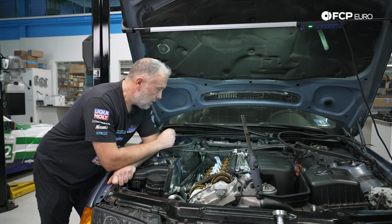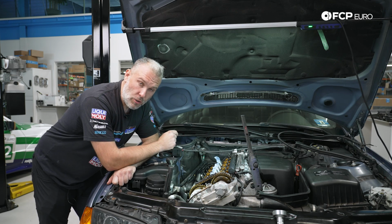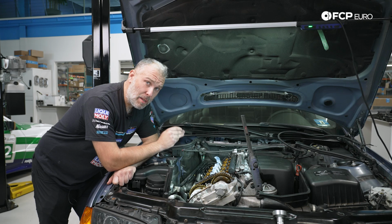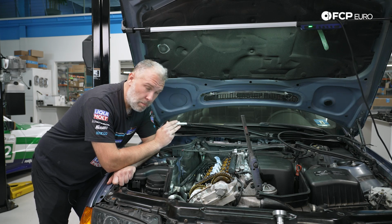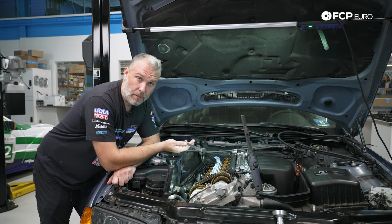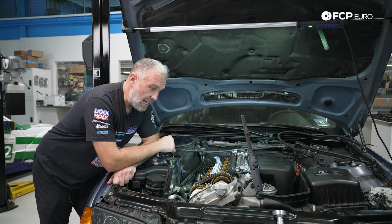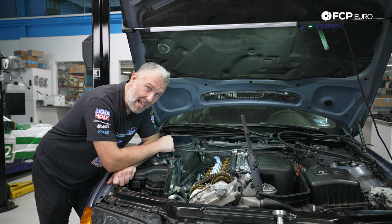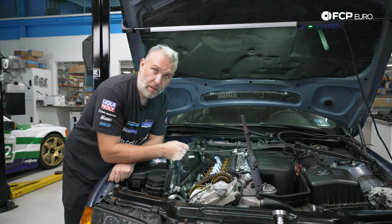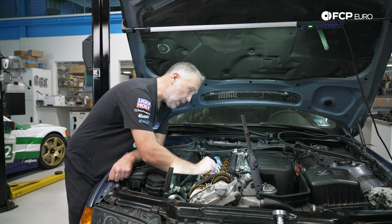So at this point, we're gonna go ahead and check the valve lash on all the other intake valves. It's gonna be the exact same process all the way down the line. We're gonna be rotating the engine over to make sure that the camshaft is pointing in the correct direction. The specification for BMW's coolant temp needs to be below 35 degrees Celsius, 35 degrees Celsius being the absolute maximum temperature. However, it is best to have the engine at basically room temperature. In this case, the car's been sitting for well over a day, so we're doing this as the engine is cold, and that's going to give you probably the most accurate reading possible on these measurements, since everything expands with temperature. So again, just going to go down the line, check all of our valve lash clearances like we did on cylinder number one, and then after that we'll go ahead and move on to the exhaust side.